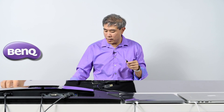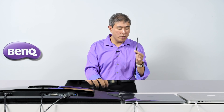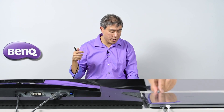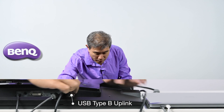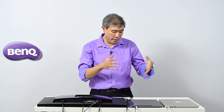Now, this USB Type-A will not plug directly into my laptop, so I'm going to need a USB Type-A to USB Type-C adapter. Alternatively, they do make a single cable with a USB Type-C to USB Type-B that you can also get. What you do is plug one end into your laptop and plug the USB Type-B end into the USB uplink on the display. Just like that, you are now able to do a hardware calibration using Palette Master Element without any error. In addition, the two USB ports on the side and the SD card slot will also work because of this USB uplink.